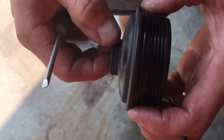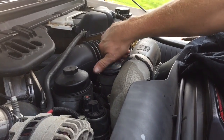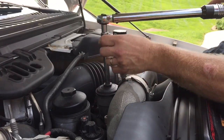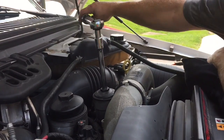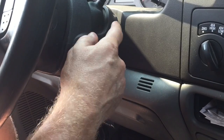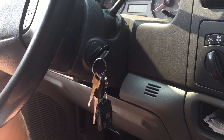And I'm ready to go back and put my cap on. I'm going to get my cap started by hand tight, and then I'm going to come back in with my torque wrench. This gets tightened to about 10 foot-pounds of torque, or 14 newton meters. I've got my torque set up. So now I need to go into the cab and turn the vehicle on for 30 seconds without starting it three separate times, and that will recharge the fuel system.